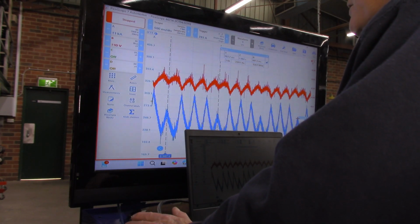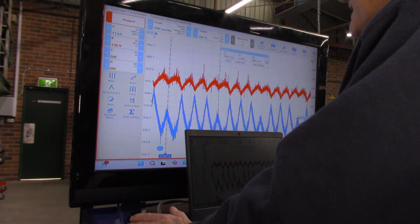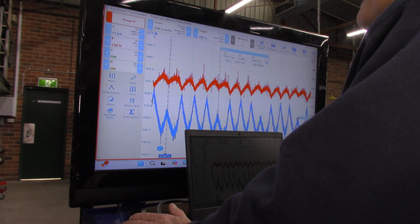On a diesel, what could cause that? Well, it could be an injector washer. It could be carbon buildup holding a valve open, valve clearance is incorrect, compression rings worn, or something along those lines. But what we're saying is it's on one cylinder. This was a Holden Colorado 2.8 DuraMax.